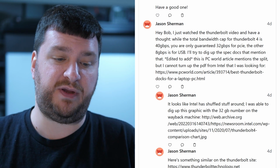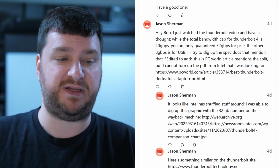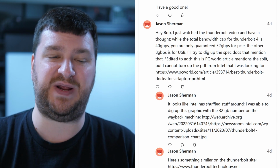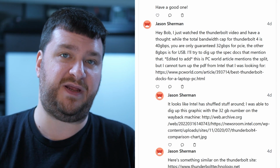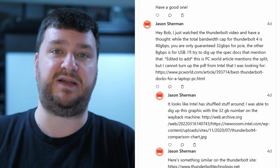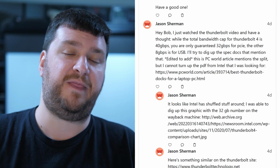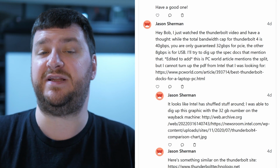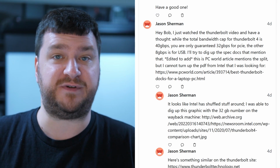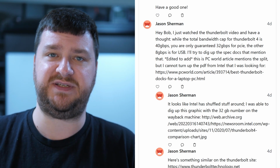So you might be right about that, but in all of my testing and in all of the awesome responses like yours, thank you, by the way, for taking the time to look into this, the one most telling thing that still is just driving all of my fellow nerds crazy is, how come you could set up a very, very fast SSD through Thunderbolt, single device on a single machine, and get supposedly a higher bandwidth throughput than video capture? And that's the thing that's confusing most of my friends who really dug in deep into this and have knowledge of how these work. The one thing that people said was Mac versus PC, the way a Mac handles single device is probably different. There was a little bit of discrepancies on that as well.